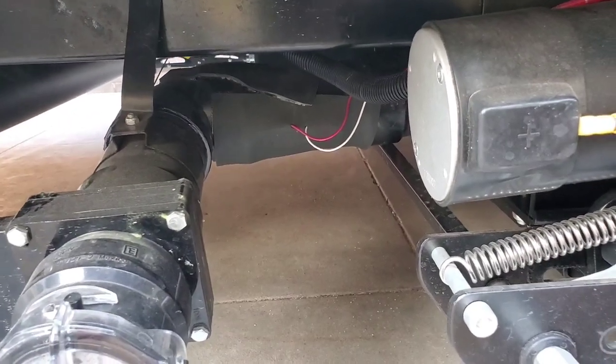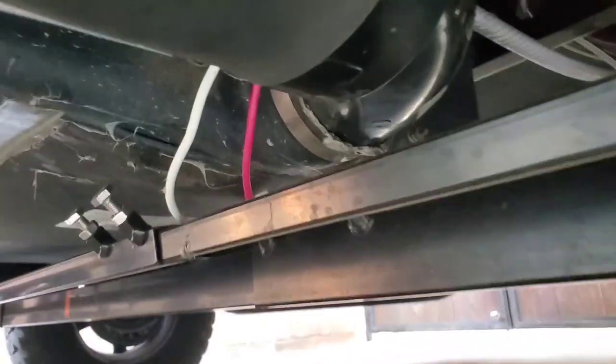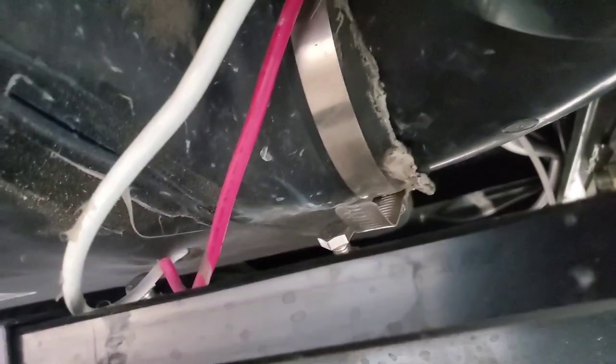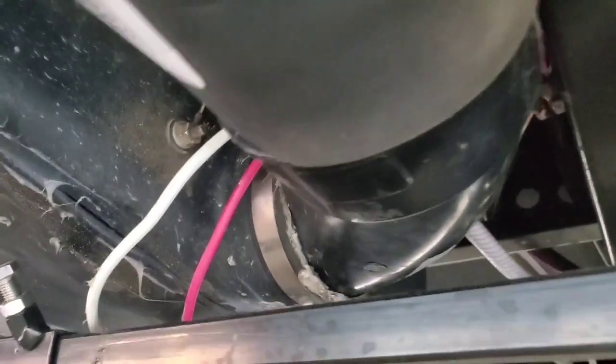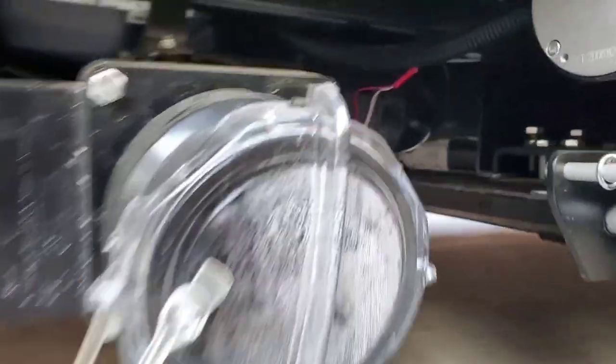And the only things I had to do was cut the existing pipe from the black tank, and then also buy another connector. There's a connector that goes from where you see that clamp, but in this case, I ditched that connector and I put in a street 90 degree elbow, which is smooth on one end and has a flange on the other side. And then just built a little extension to move the pipe over a little bit, and then put another elbow in, and just used the adhesive for ABS pipe, and everything stuck together pretty good. And it looks fairly OEM, I would say.